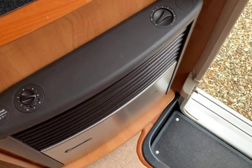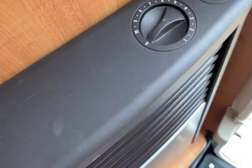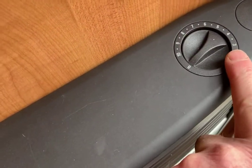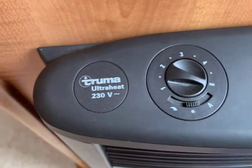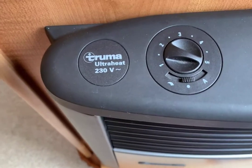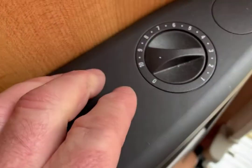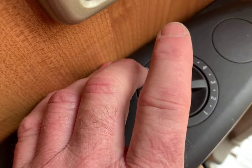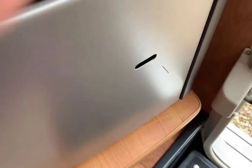The heating on the gas fire is a simple procedure. You've got two knobs. The knob on the right is the ignition knob and controls the amount of gas. To turn it on, just turn the knob and you'll hear it clicking — that's the automatic igniter. Press down and hold. You might not have heard that but she's fired up. There's a little port there that you can look through and see a flame.